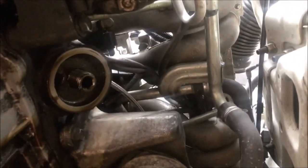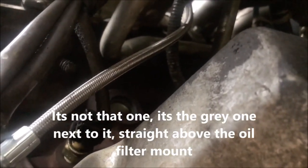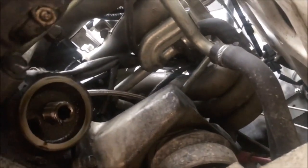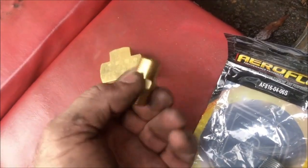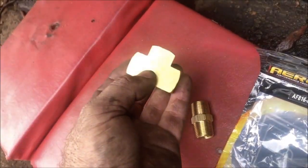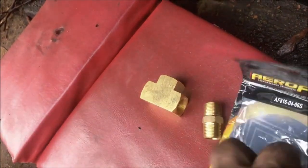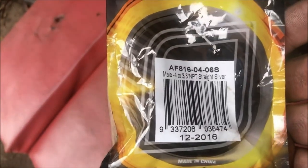We'll get back under there and try to fit the oil return. It's very difficult to see. I've removed the oil filter. Up here I believe is the oil temperature sensor. It's the oil line we need to tap into to get our pressure for the turbo oil feed. The block has a 3/8 thread in it, so you need a double-ended male 3/8 adapter, a 3/8 female T, and a dash-4 3/8 NPT fitting.